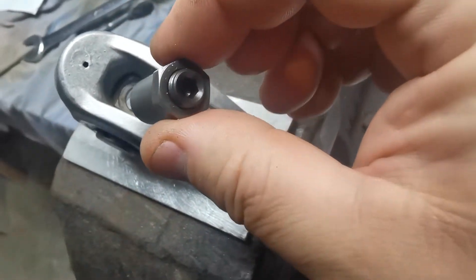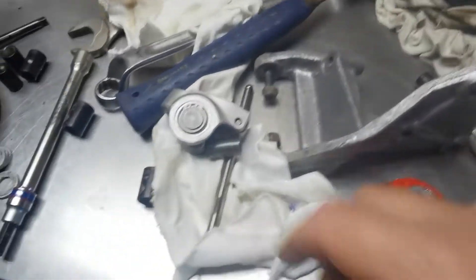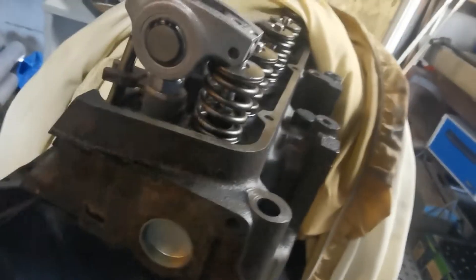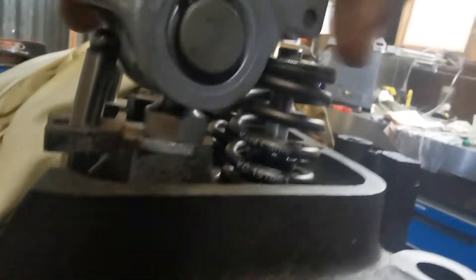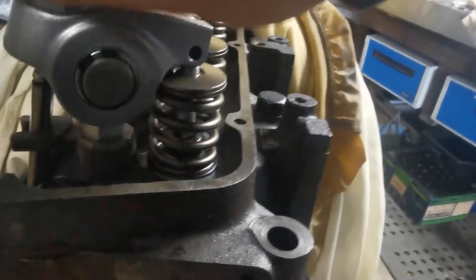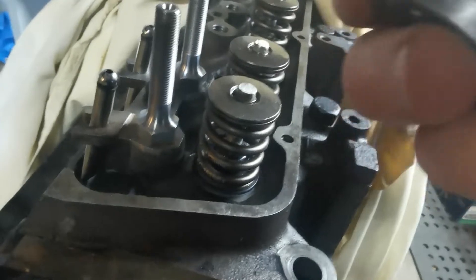So that sits in there like that when you adjust it up. The problem is these push rods are 148.29mm approximately. Looking at this with no contact at all, it's bottoming out on the thread inside the rocker. When I flip the rocker over the pedestal shaft, it's this piece here that is hitting on the bottom of the thread.